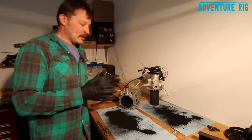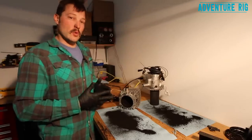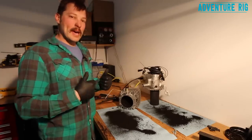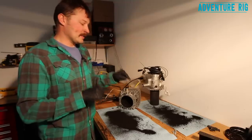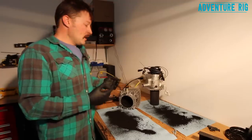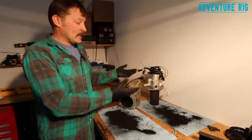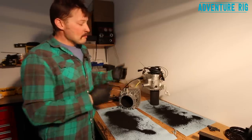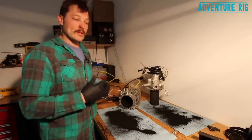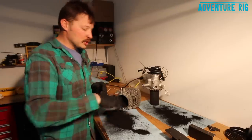We've spent some time cleaning this and you can see exactly what we got out of the heater. That would be why I wasn't getting any heat and why this guy was smoking as bad as it was. So again, if you have this heater and you have that function to run at a low setting, remember to kick it back up every once in a while or the inside of your heater is unfortunately going to fill with soot. It's really not that big of a deal to pull apart — a little bit of a pain, but not the end of the world. It was five or six screws, these two halves split. Now that it's clean, all I'm going to do is put it back together the same way I pulled it apart, put those screws back in, make sure you hook up any wires you had disconnected, and then throw it back into the floor where I had it mounted. Hopefully I won't ever have to do this again. I'm going to start kicking my heat up every 12 hours if I'm running it at that low setting to hopefully burn all this off.